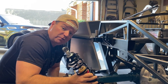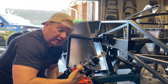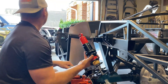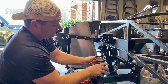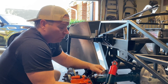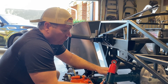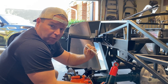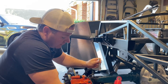Like the front, you have to assemble your struts — it's pretty simple, exactly like the front. These are a little bit longer so you'll know you're using the right ones. You use the 350-pound spring for the back. Both will be body-up; if you have a clearance issue you can mount them body-down. One key thing: Factory Five doesn't send you the spacer hardware you need here. They say to use the factory stuff from your donor, but the donor didn't have a spacer. So you've got to go to ACE Hardware, get a 4¼-inch bolt and some spacers from the little drawers, and fit them in.